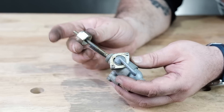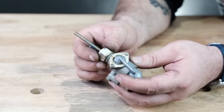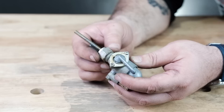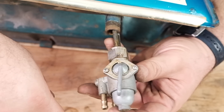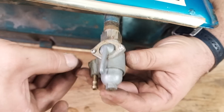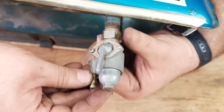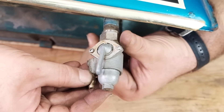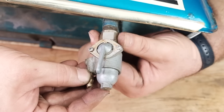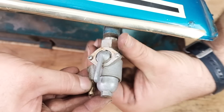The large nut is installed back onto the petcock smooth side up. Thread this back onto the petcock counterclockwise by only about half a turn — don't thread it any more than that. When you go to screw the petcock back onto the tank, hold the petcock in place and just turn the large nut. It's designed so both sides will then thread into the nut equally, meeting in the middle and sealing on the o-ring. It just needs to be snug; don't over-tighten it.